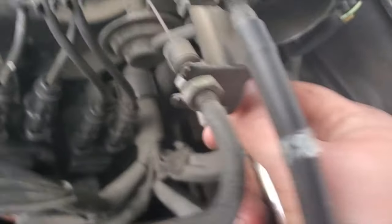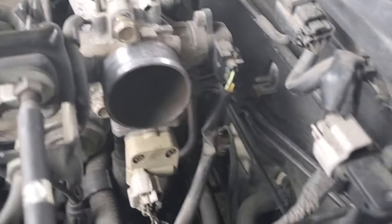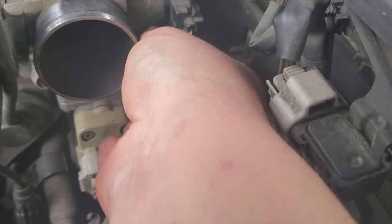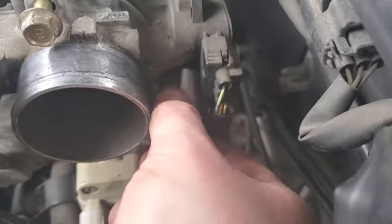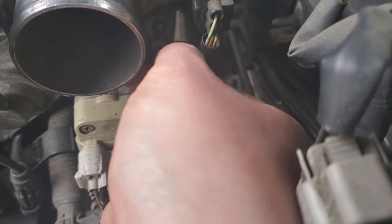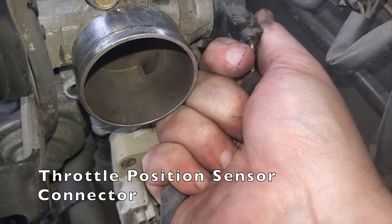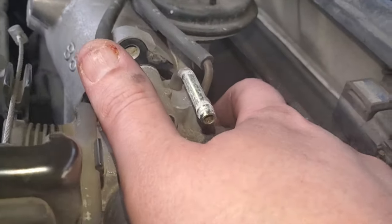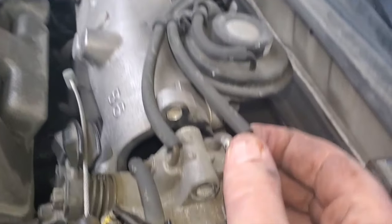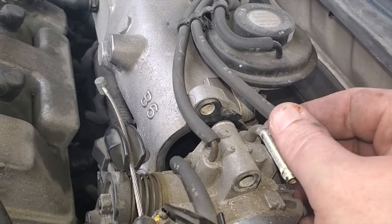I'm tightening it in stages to prevent any kind of surprises. I think I can get to these by hand. As a heads up, I would remove the bottom two first and then remove the upper one, so you don't lose any bolts. These are pretty long screws, and that does not surprise me. Before you remove that top bolt, you should probably remove this electrical connector. With the throttle body tapped off of there, it's naturally loose now. All I've got to do is actually take these hoses off here. This hose goes from here to here. This hose runs from here to here. You may want to remove these too.